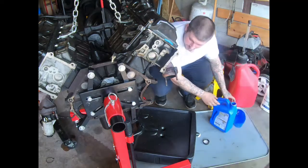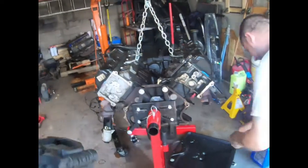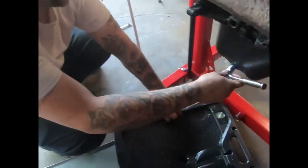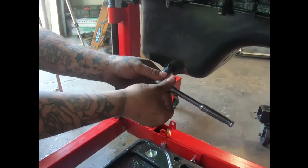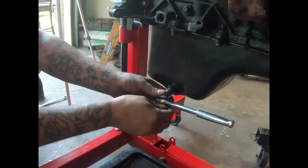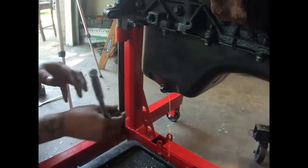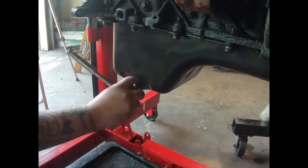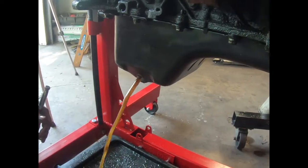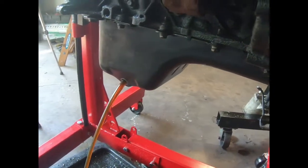Yeah, so it's coolant in the oil. Let's get some of this good footage. Get y'all in a little bit closer. Here you go, bro. He's trying to save that oil, but he said, get it now. Yep, got full of coolant. Yep, that's no good. Motor didn't even run and got milkshake.